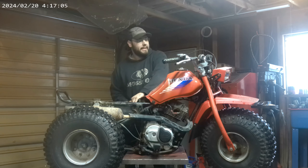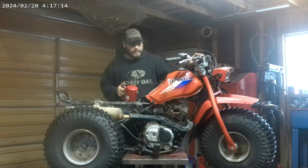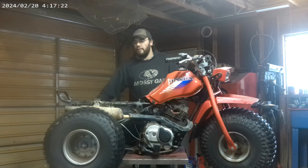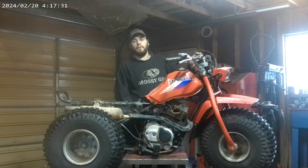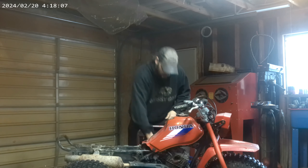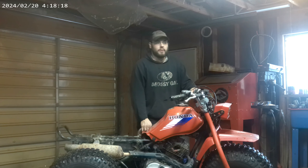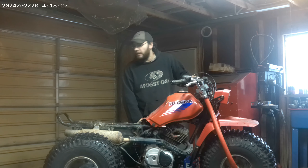The first thing I'm going to do is just put a little bit of gas straight into the intake here. I have a little sprayer — essentially it has two-stroke mix, so a little bit of oil in it as well. I'm just going to see if I can get it to just pop off real quick. It is in neutral, and the pull start appears to have given up. The pull start doesn't grab until it's almost all the way out — that's another thing I'll have to repair in a little while. So in the meantime, I'm going to put it back up and try to hook a jump box up to it and see if the electric start works.